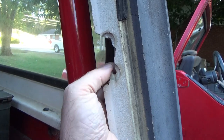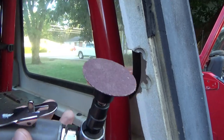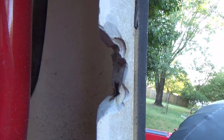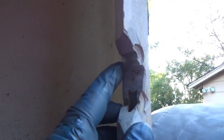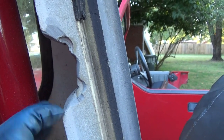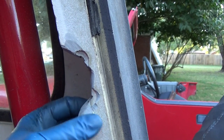First thing that's got to be done - I'm gonna get my little die grinder set up here and get in there to clean this up so I've got some clean surfaces to work with. Now before you fire up that little sander and start sanding all this stuff out, get your safety glasses on and get a mask, because you don't want to breathe that nasty stuff. Safety - do it. Now basically my goal on the back side was to chamfer back a little bit at an angle. Instead of grinding this off and leaving it at a hard 90, you want to be able to feather the glass off on the edges.